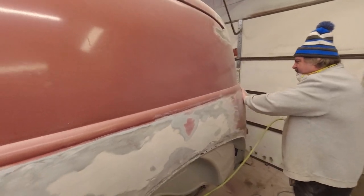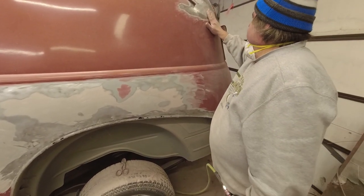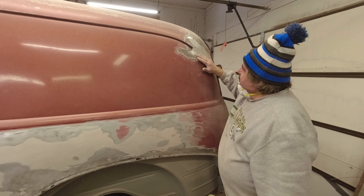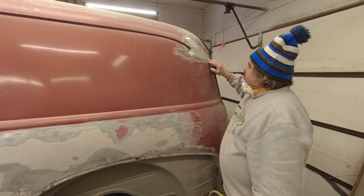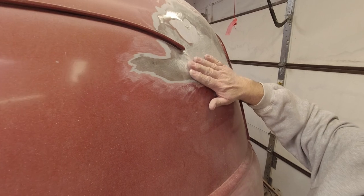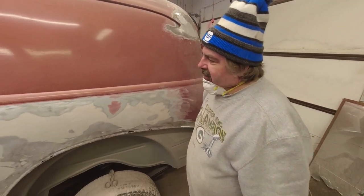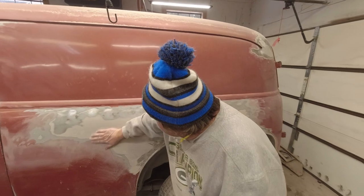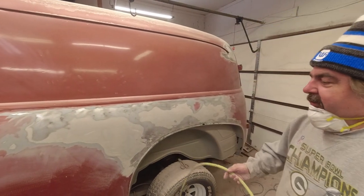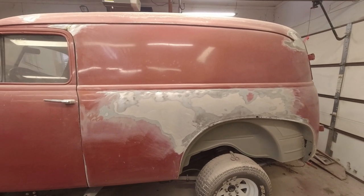It's coming. We'll start welding patches on — that's going to be the next step, and then a lot of sanding. We're going to have to put some putty in here and fix a couple of these little rust spots, because the body line just isn't perfect right here. There's got to be a factory body line right here — the metal is softer up here and then it gets real hard here. So we're going to have to put a little bit of putty back in there to clean that up. We did knock a lot of the issues out of the body waves here — that's going to be huge. It's going to help like crazy when it comes to the bottom of it. All we're going to do is keep sanding and we'll keep showing you everything we can.